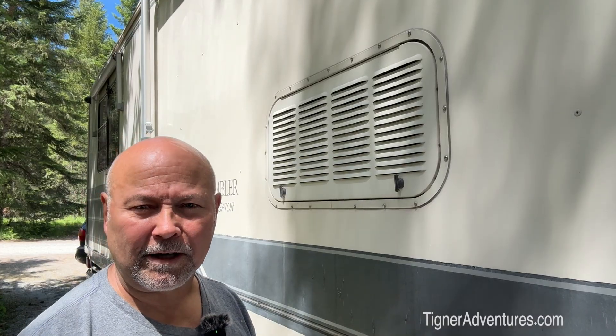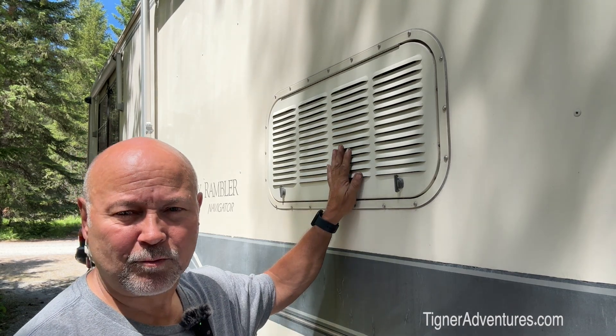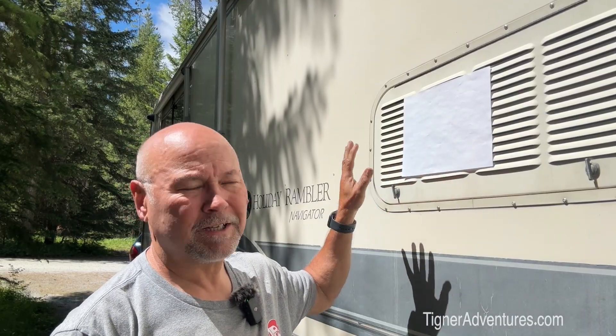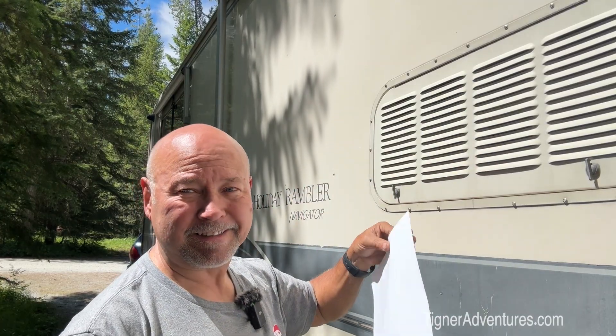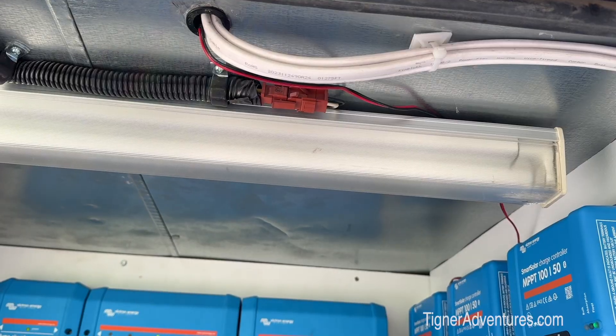I haven't figured out where to put a fan yet, but at some point I need to put some fans in here to help cool this down. Something I just recently finished a couple days ago — because of heat issues our refrigerator has had some issues dissipating heat. Using these fans I installed those in our old rig to help circulate air through the back of the refrigerator, and I have done that on this rig now too. If I take this piece of paper and put it up here you can see how much force it's pulling air in through these vents and pushing it out the top.